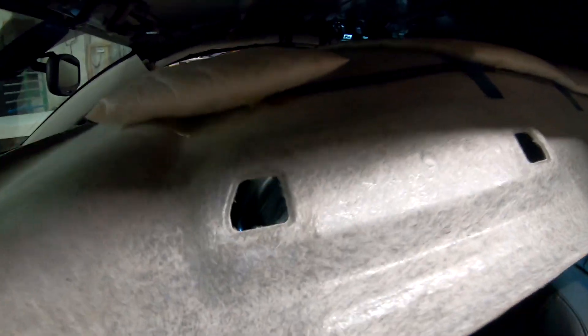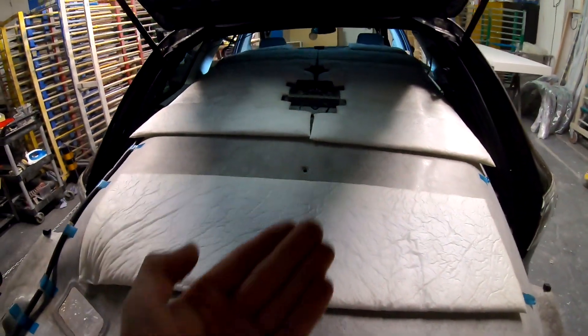Here is the wiring — don't worry, all this wiring on the passenger side runs along, along, along until here. Remember this plug we disconnected earlier? We removed all of this to disconnect it. It's going right here — this is the plug that goes there. Now we should be able to slide this out. Obviously move the seat belts to the side. Pull out slowly; try not to catch anything because it will catch on some things — this end is catching here. You need to pull upwards and downwards to navigate it out.